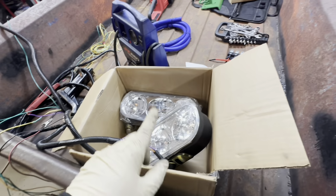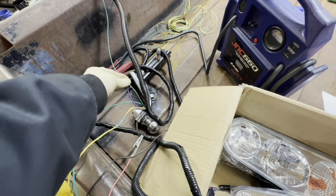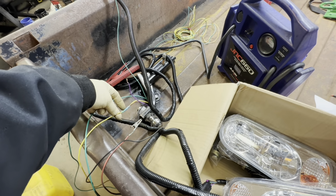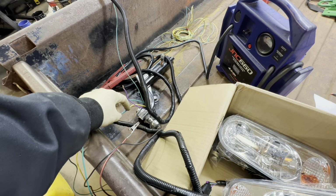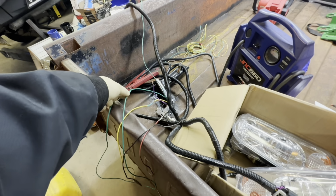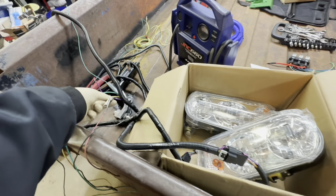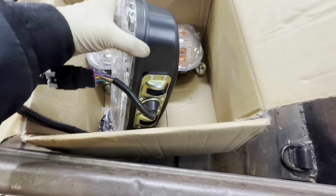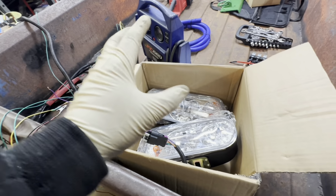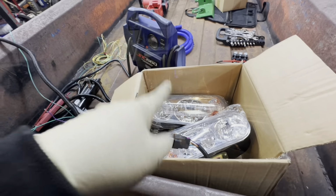But with this, when I redo the big plug, I will put the turn signals in there, which is, I think this one's left and that one's right. And then this one, yellow, is low beam, with the brown wire being the marker light. And this one's being high beam. And we got a ground. Super simple. So we just got to drill a couple holes. I'll mount that. I'll show you that. And I should have legal headlights. The turn signals won't work until I do the plug, but the plug is coming sooner than later.